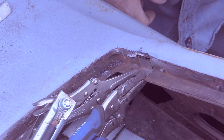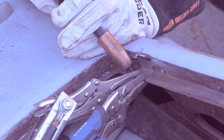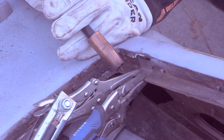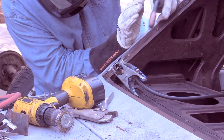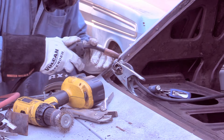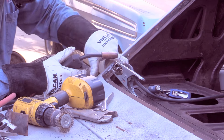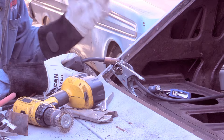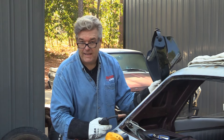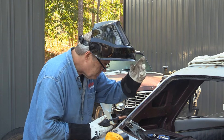I'm going to leave my settings on low-one on this welder and move up to a five on speed. That one didn't take, but those did. That's popping out through the center because of the dirty metal underneath — it's actually pulling rust from the pinch of these two panels. Not a lot I can do about it. If you know what to do about it, please leave me a comment below. I'd love to hear from all my welders, armchair and otherwise.